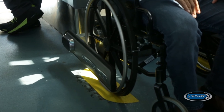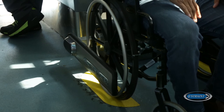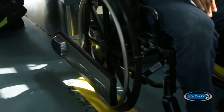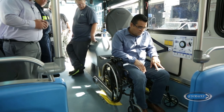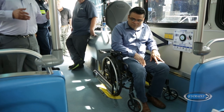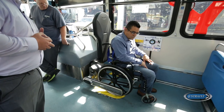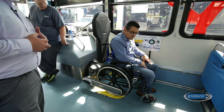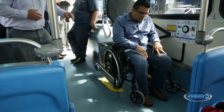All without any operator assistance. What you're hearing now is the initial squeeze, which puts 25 pounds of pressure on the chair. The bus operator would then push the button on the dash, which initiates the final squeeze, adding an additional 25 pounds of pressure, totaling 50 pounds securing that chair right now.